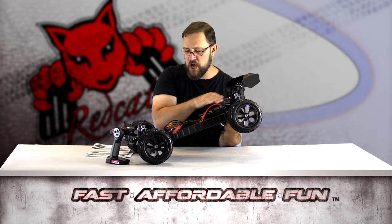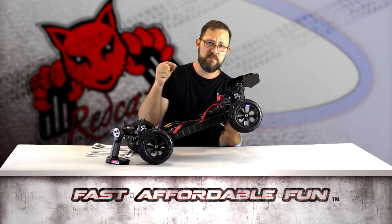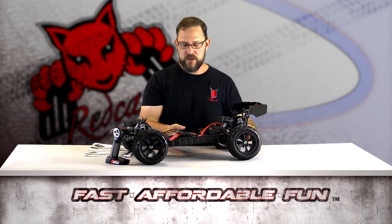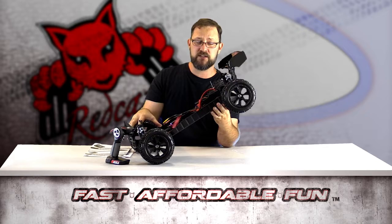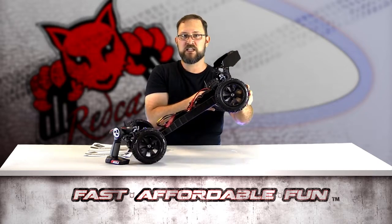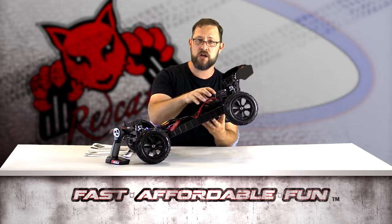So what that does is shocks the entire drivetrain. It shocks the gears, it shocks the joints, it shocks the pins holding things in place, it shocks the pins in the dog bones and the dog bone cups. It just shocks the whole system. Now with a center diff, what happens is when you land and the front wheels stop from contacting the ground, the rear wheels are, see this, I'm going the same way here, the rear wheels are still allowed to rotate before they touch the ground, which removes the shock from the system.